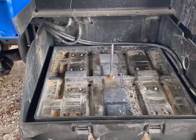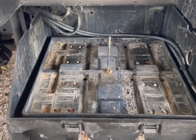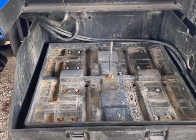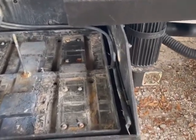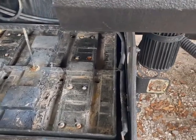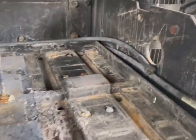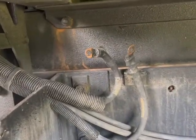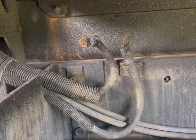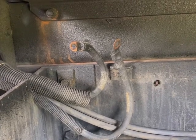So here we are again — batteries are cleaned out and this is basically what it looks like. May not look like that on yours — that's my disclaimer. I was wrong about a couple of those wires. First off, this over here is the NATO connection for the charging system. With that removed, you've got: this goes to your forward ground, I believe this to be your 12-volt hot — I'm going to check that — and then over here you have 24-volt hots which go to your diode box, your polarity box, and one goes to your starter.